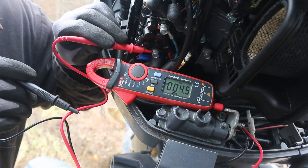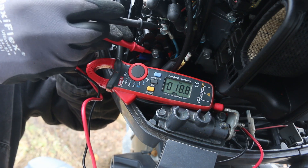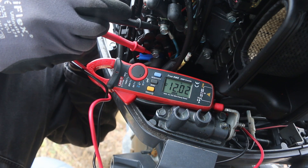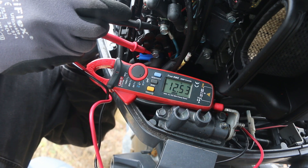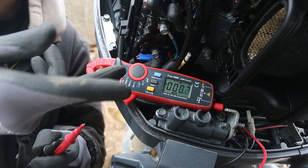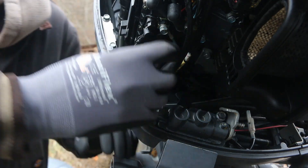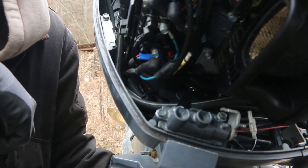I'm going to connect one pin here, the other pin there, and flip the switch. As you can see, we've got 12 volts, and in the other direction we also have 12 volts. It reverses the polarity to control up or down by running the motor in the opposite direction. So we know electrically everything is working here — pretty much it's the motor.